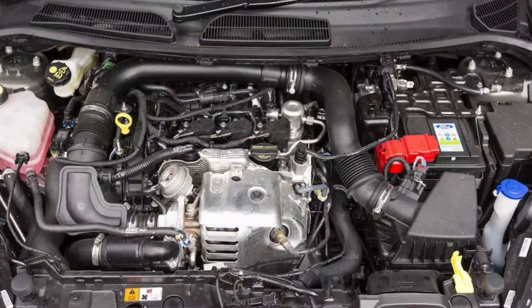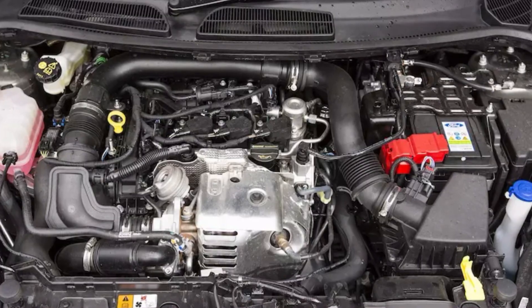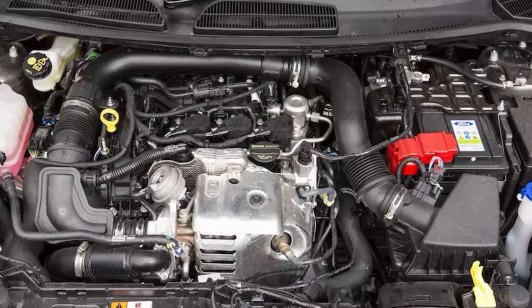The easiest thing to check is the air leak. You will need to inspect the entire air intake system. The pipe may be broken, the filter may be absolutely clogged, or the filter box may be clogged. Just inspect the system to make sure that clean air gets directly from the filter box to the throttle and doesn't escape the path anywhere.